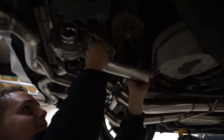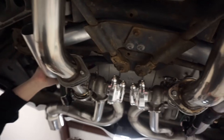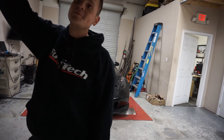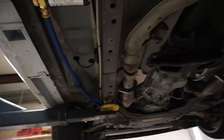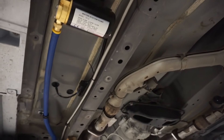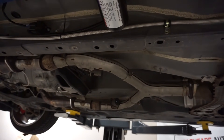We got charge pipes happening — some portion of the charge pipe started to fit up. We got kind of our y-piece going up from the one turbo. We're making like huge progress. As of right now we only had one small downside — how loud the actual pump was. The pump was so loud. This really generic pump works really really well, seems to move a ton of volume, and it's self-priming so it definitely was pulling the oil out as fast as it could go. You can run it dry without having to worry. It wired up pretty easily with the relay. The only thing is it's so loud that you can't hear anything else at idle. We got a quiet pump on the way.